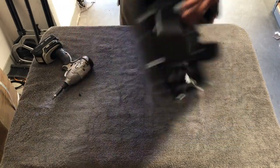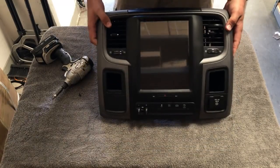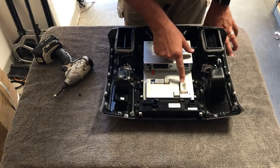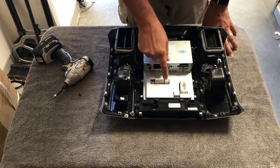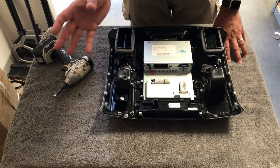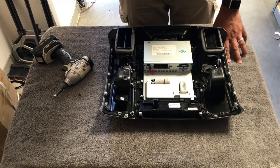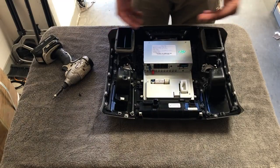There's our one extra screw, and if we flip it over you can see it sits in there nice and flush just like the factory one. Back in the truck — let's talk about what we're plugging in and a little about climate controls. Depending on which climate control you have will depend on which plug you use. If you've got the automatic or high-end version with an 8-inch screen and touch screen climate control, you'll use our adapter with a small plug. For the 4-speed and 7-speed with the smaller screen, the factory plug plugs directly in.